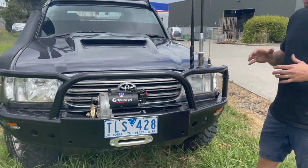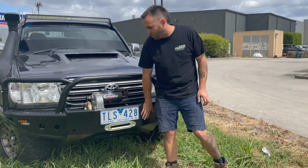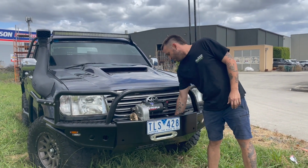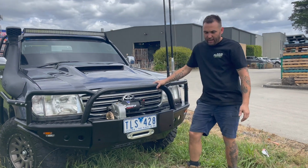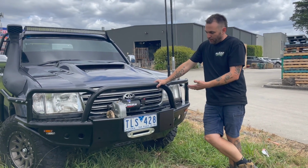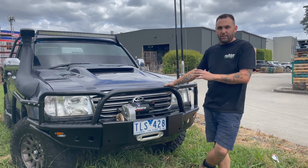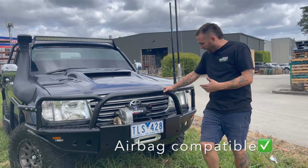It's another few little changes which we've done. We're moving to where all of this is one folded unit. It's just again bringing a bit more technology to things. It's a bit less welding and stuff. A common thing is, when they hit a big enough rock, they bend the bottom, so we're going to make that a little bit thicker, but we're doing a few other things to cut weight to compensate for it. Obviously they are airbag compatible, being a later model car.